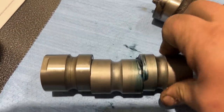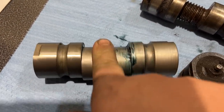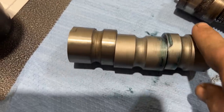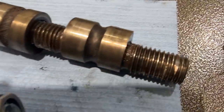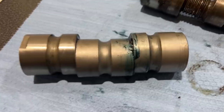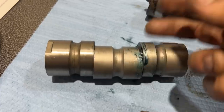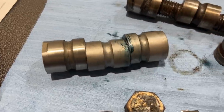This eccentric knuckle pin is how you adjust the caster and the camber on there. And the grease fittings put grease right in the middle of those, and that's why those old ones were so worn, with the threads so bad. There was so much movement and play in there, no way to keep it set. So as you back one of these off, because it's oblong, it moves it and adjusts it. Again, caster and camber are set by that.